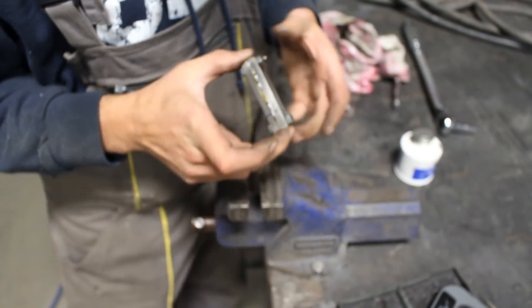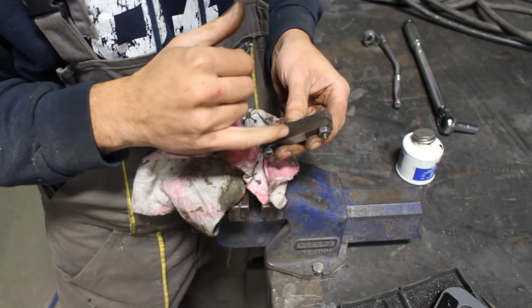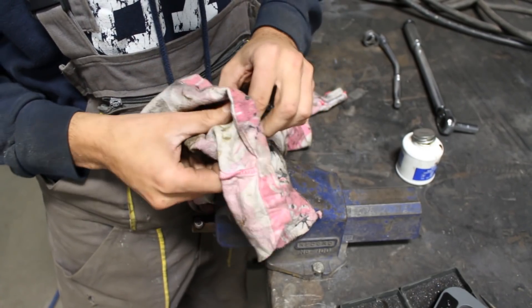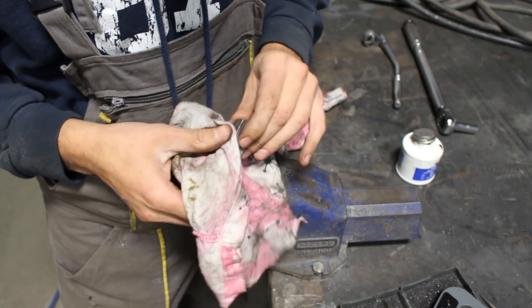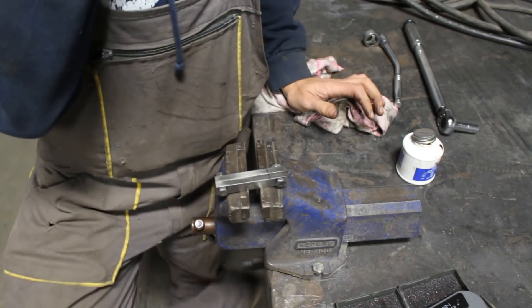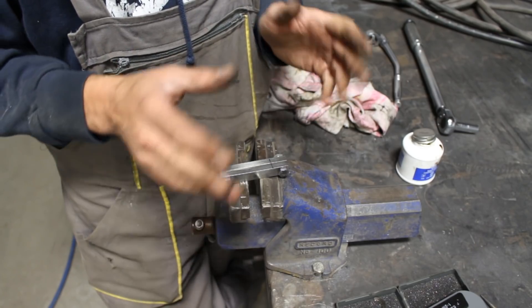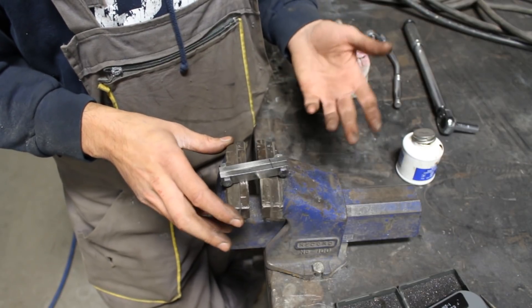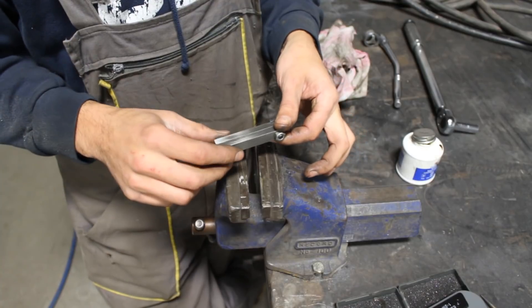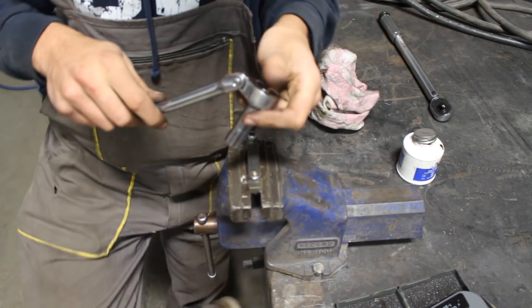There's absolutely no difference — no gasket maker and with gasket maker, and the reason for that is I believe the gasket maker only stays in the uneven parts where we have little dents in the metal or little gaps. But where the two metals touch, it's not there anymore. So I was planning to do some calculations — if it was say one thou, then in the overdrive it would actually be two thou because we had gasket maker on both sides of the plate, so the end play of the sun gear would become 16 thou, which is still in tolerance. But I don't need to do any calculations because this is proving that the gasket maker doesn't have thickness. Thanks for watching — let me take this apart and clean it.